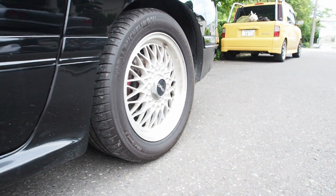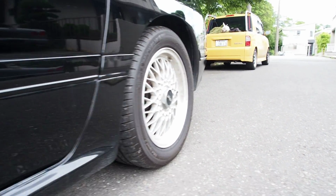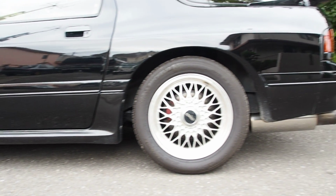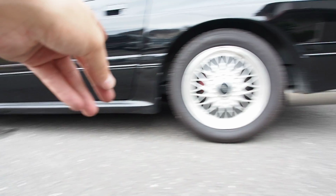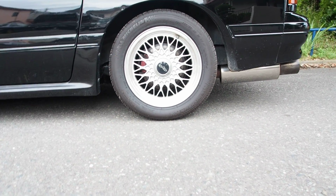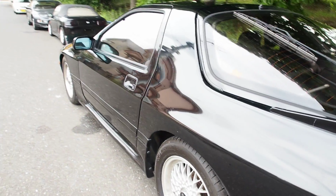Okay, we have slightly wider tires in the back, 225s in the back, 205s in the front, and cool wind here, Michelin Pilot Sport 3s on the car front and back, so the previous owner knew what was good for him. And of course, Michelin Pilot 3s are always good for you. And they're 2014, and so they're still absolutely usable. Wait, 2014s on the back, 2011s on the front. Fronts are older, but still kind of 70% tread. Backs are newer with 30% tread, so obviously the previous owner was somebody who enjoyed his car very much.